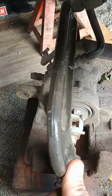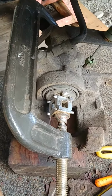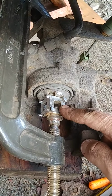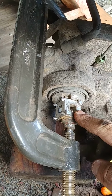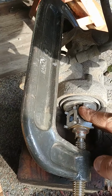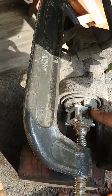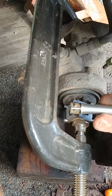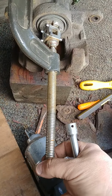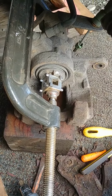I've tried a couple different methods, but I think I came down to something that's kind of easy and simplistic. And like older brakes that I used to do, I would put a 6-inch C-clamp on here. So what I found is if you take one of these brake tools that you have for normal caliper winding, which are not super rugged but do the job, if you put that in there to where the little nipples are in and you have the flat back, you could take your C-clamp and put it around, and as you are turning with these, which just is putting in a simple 3/8 extension in here, as you turn that to the left, you turn this bar to the right so that you're putting pressure on it as you turn it in, and it worked like a charm.